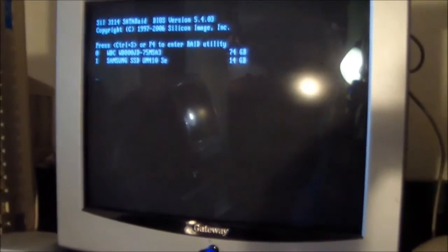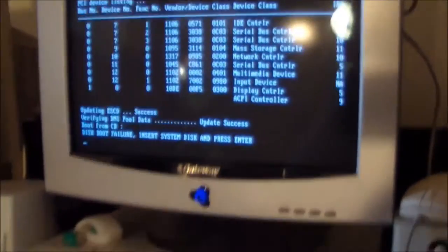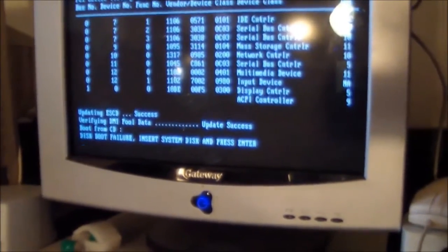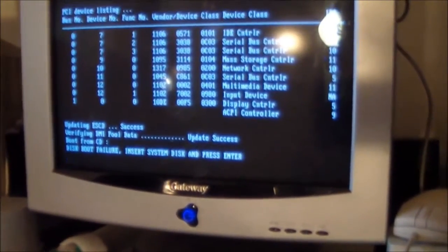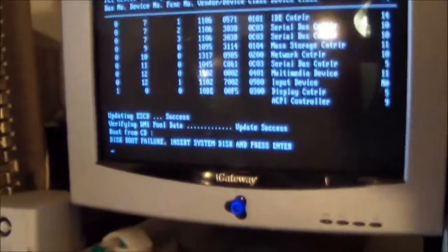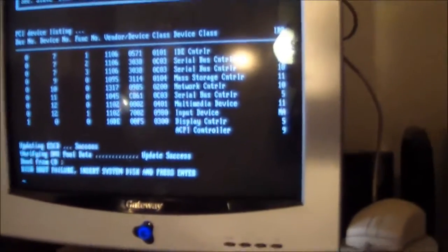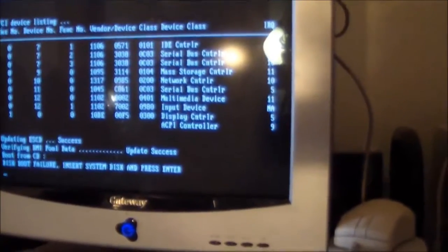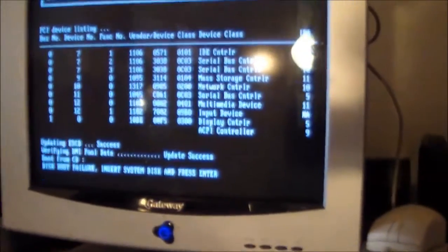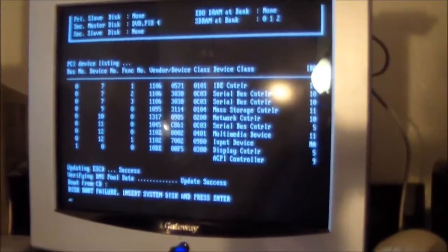Okay, there's that RAID card. Looks like it's detecting our 2 drives, boot from a CD. Okay, it looks good. I got a boot disk failure, of course, because those drives are blank. There's nothing on them. But it looks good. Better than I thought. Everything's looking good here. So I just have to try to install the OS. The only thing I saw maybe is I think the hard drives got flipped around. We want 0 to be the, well, it said 14 gigabyte drive. That's still fine. And we want the bigger 80 gigabyte conventional hard drive to be our secondary drive. So that's about the only thing. That's just a quick cable swap, and then looking good.